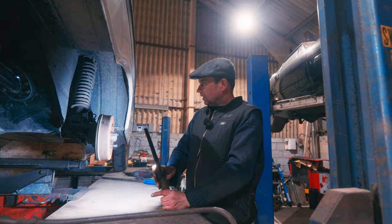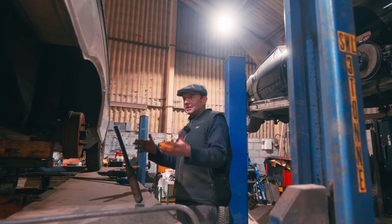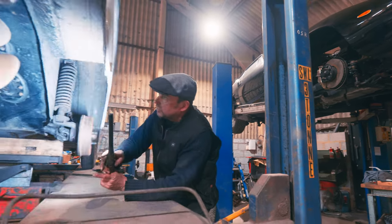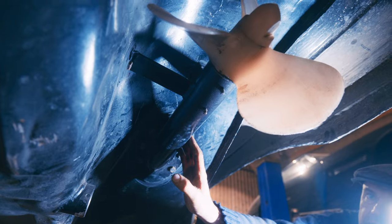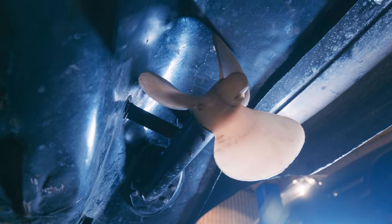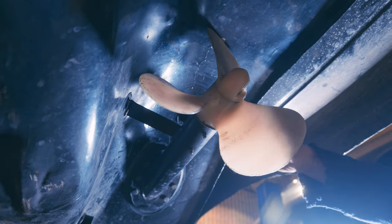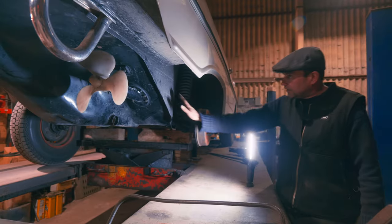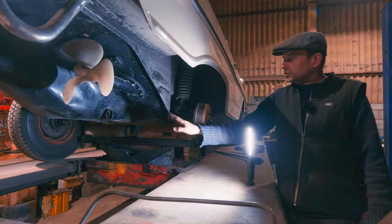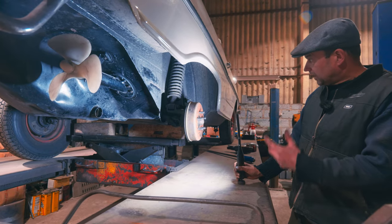You're supposed to fully grease the car after every immersion in water, which obviously doesn't always happen. We've also got some grease points on here - two grease nipples on this shaft because we've got bearings in here. A few years ago I took all this off and I rebuilt it with new bearings, seals and so on, and then we keep it wedge full of grease. My other job on servicing is to make sure that there's paint on everything - if I see any little areas that are bare metal, I paint them.